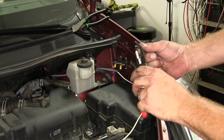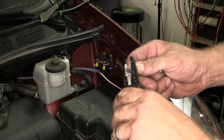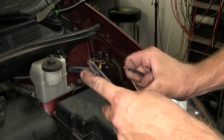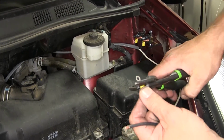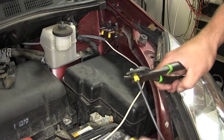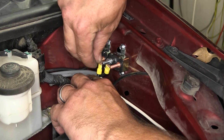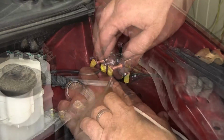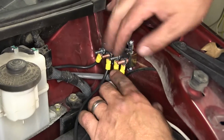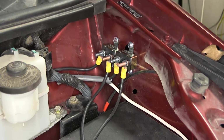Now, once we've taken the black wire out of the remaining gray duplex cable, we'll go ahead and strip back two ends. Both of these ends, we'll add small ring terminals to attach to the breakers. Go ahead and attach them to the breakers now. Once we have all the serrated washers and nuts onto the breakers, we'll go ahead and tighten them down.